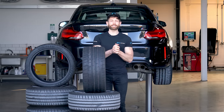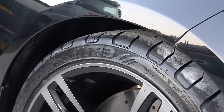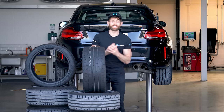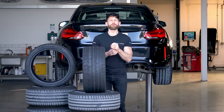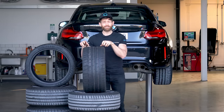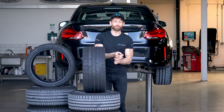And there we have it — that's my six tyre tips and a number of car tips. I hope you've enjoyed this little guide. If you haven't listened to a word I've said, please at least check your tyre pressures before resuming normal motoring, because it's so important. Under-inflated tyres build up heat on the shoulders and then fail, usually at high speeds — plus you're going to spend more money on fuel.